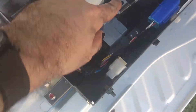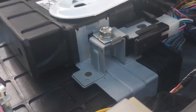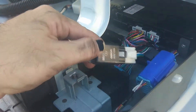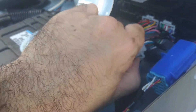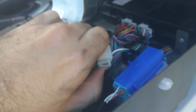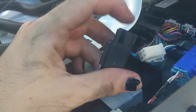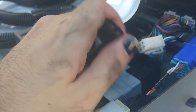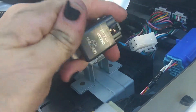See this relay here? We're going to want to pull that out — it's a 10mm socket. Go ahead and figure out where you left the 10mm socket and then come back here. Once you've removed that 10mm bolt, press this plug and really gently try to pry this relay out of its connector. Be really careful — it's very easy to accidentally pull the cover of the relay away from the connective bit and expose the relay itself, which you super don't want, but you can do if you really feel like it, I guess.